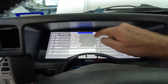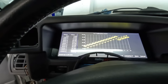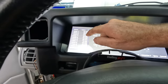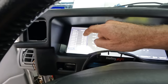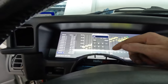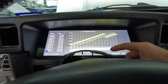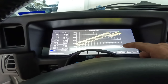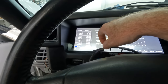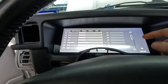So, fuel level, and we are going to do custom ohms. Settings. Oh, look at this. 0 all the way to 100. And I think, or 2000. So I think based on this, I want to say it's probably closer to 200 based on what I read and what he's told me. So let's just do 200, and we will do linearize X, linearize Y. So there's all our values. Half a tank is around 50%, it's 100, right? So we'll do save here.